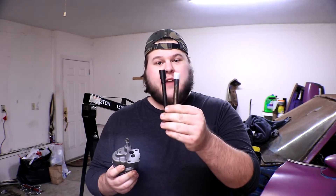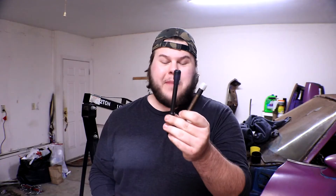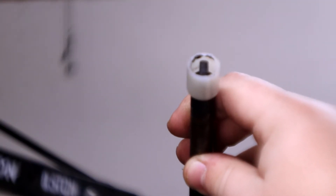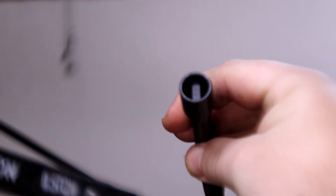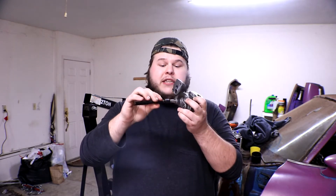Now here I have two separate driveshafts, and one is a lot older than the other. This one is actually the original driveshaft that came off of the original engine here. This one is brand new, and I'm going to show you why you should almost always just bother upgrading to the new one. If you look inside there, you can see the little vertical pin and the plastic bushing that holds everything together. On the new one, it's a metal housing with a metal pin on the inside, which is just a lot more durable and will work so much better. Both driveshafts do connect the exact same way — there's a slot here, and that vertical pin on the inside just connects together.